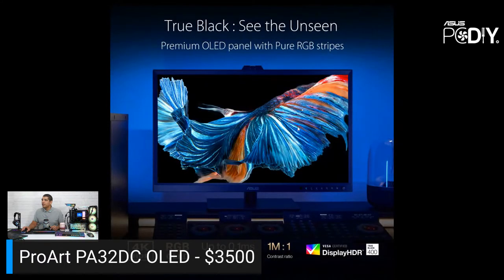With a professional display, you do want to maintain color accuracy over time. A lot of people forget about this, or maybe they don't have a colorimeter, or they forget to use the colorimeter. The great thing is we've integrated the colorimeter into the monitor. You can set it up on an automated basis, maybe every 3 weeks, every 5 weeks, every quarter, every 3 months, and it will automatically check the monitor for color accuracy and allow you to ensure you're getting the best color performance. The reason is that color performance will change, what we call drift. Essentially it will get worse over time, so you do need to recalibrate your display for the best experience consistently.